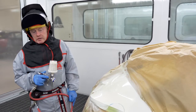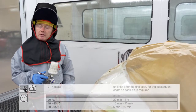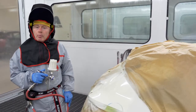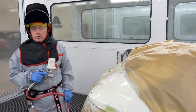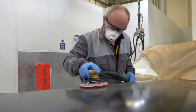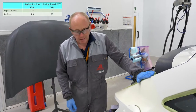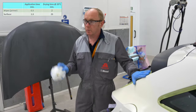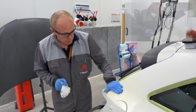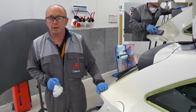Ordinarily I could leave the car in here but as we need the cabin for another job I'm going to put this outside and leave it to air dry for around 20 minutes in the conditions we have in the shop. During this time I'll prepare the bonnet for the wet on wet and mix my colour ready to do the job. The car has now been standing in the workshop for 23 minutes; in that time I've managed to prepare the bonnet for wet on wet and my colour is mixed and ready to go. Just like any normal 2K surfacer or filler I'm going to sand this in readiness for the top coat.